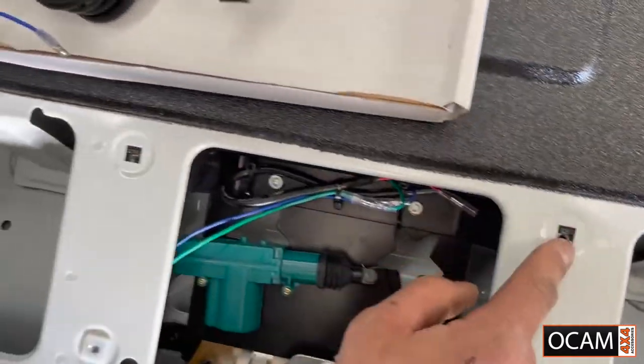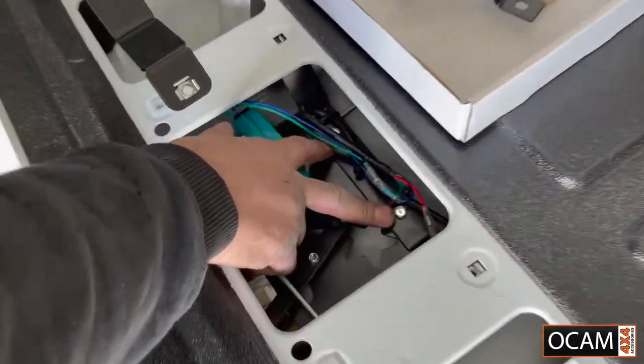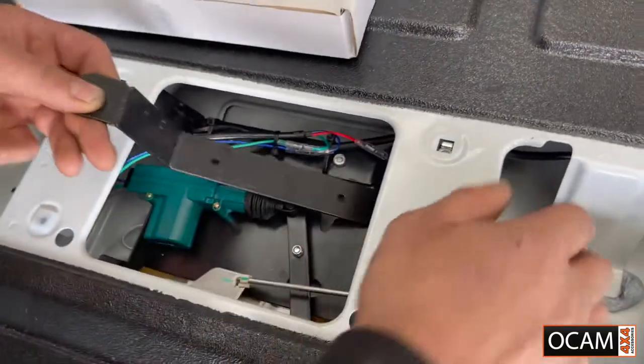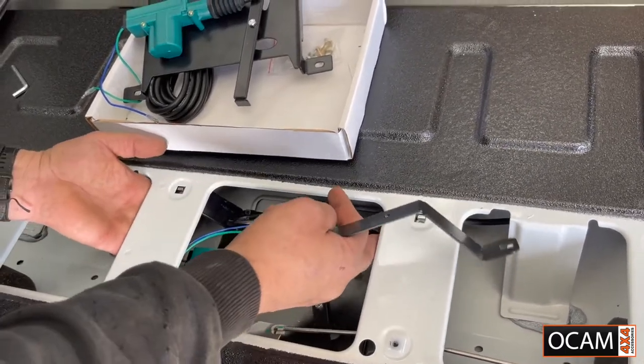The purpose of these is so you can put your cover back on — once your cover goes back on, you've got mounting points. You've got two 6mm bolts that hold this bracket. You can see these holes — it slides in into place and you bolt that in. Make sure these line up so you're not having a hard time putting the cover back on.